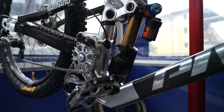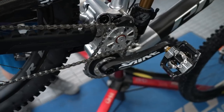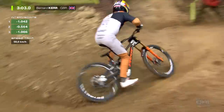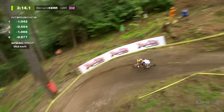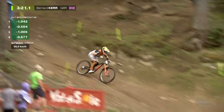Apparently Wolf Tooth have been involved in a lot of the machining. They have been making a lot of custom chainrings. The idler is different — they're doing that for more chain wrap. That's a good thing from a reliability point of view because you're less likely to break idler teeth. The downhill world cuppers are doing that partly for chain wrap benefits — you want to reduce friction as much as possible. Some of the earlier high-pivot bikes were losing chains quite a lot because there's physically less chain on your main chainring than if it wraps all the way around.